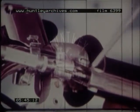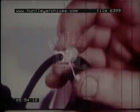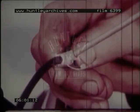To lubricate the cables, operate the levers and apply the oil can so that the oil works down inside the cable. On some machines, a special oiling point is fitted to the cables to make lubrication easier. Don't forget to operate the lever to distribute the oil along the cable. All cables should be lubricated at both ends. Any surplus oil helps to protect exposed parts of the cable against rust. Chains that are not kept well oiled will wear quickly. To lubricate, turn the chain and drip oil from the can over the links, and remember when you've finished, to wipe off the surplus.